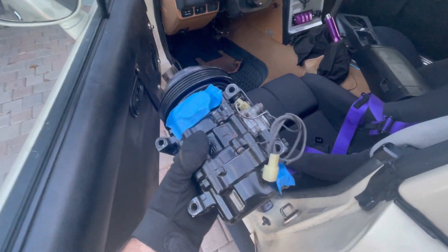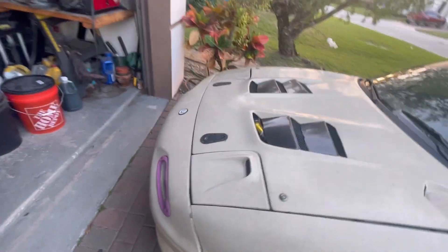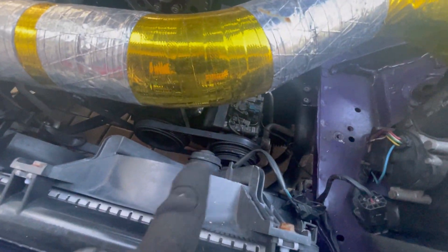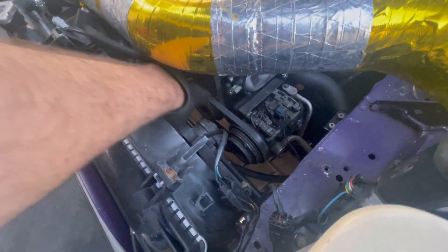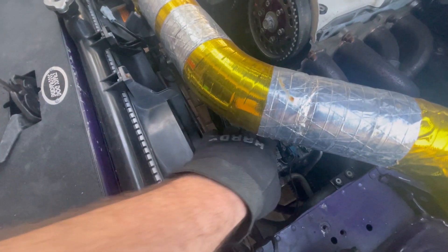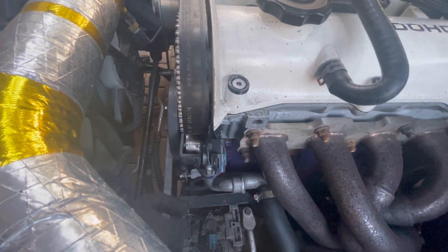In the meantime, this is what I picked up from my friend yesterday — an AC compressor, fully rebuilt. I'm going to go ahead and take this out and hopefully install it. Probably won't finish today but just do most of the work. Here is the open hood — you can see my old AC compressor right there. I've done a whole AC system rebuild, replaced all the seals, gaskets and everything, and I think this might be the culprit. You can also see I've gotten rid of the tensioner for the power steering and run a belt directly from the pulley. I do have a supercharger I've thought of putting in, so I want to use the pulley system from that since I don't have regular power steering.